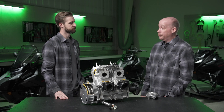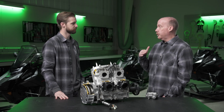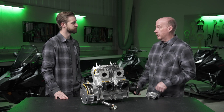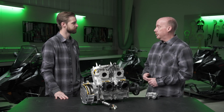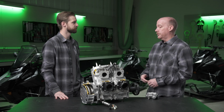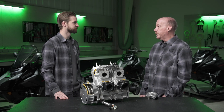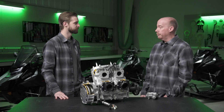Rather than just cutting off exhaust flow, we're actually manipulating the entire area of the exhaust system. What efficiencies or benefits do we see? This exhaust valve system offers about 250 percent greater range than our existing exhaust valve system, which gives us much better run quality at low end, helps with torque, helps with emissions, and gives us a better overall engine package — which was a key requirement from the very beginning.